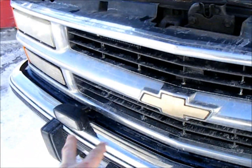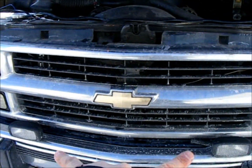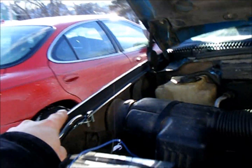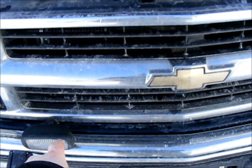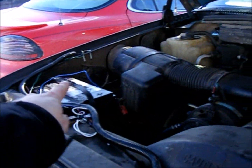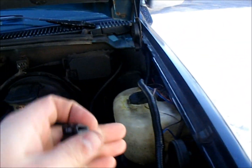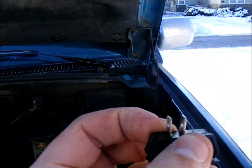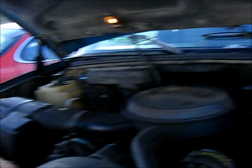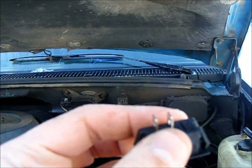In summary, each light has its own ground and own power. I took each of the ground wires, crimped them into one, and ran them up into here. Then I took both the power wires, crimped them into one, and ran them into the cab. At the same time, I took my blue wire and my power wire and ran that into the cab as well, and connected them both onto here. That way your truck is the ground, you get your power from your battery, and it comes out to your fog lights with a simple little switch.